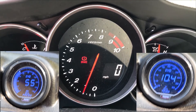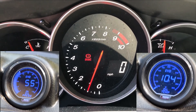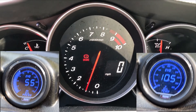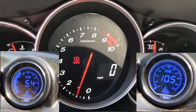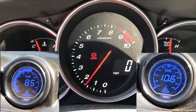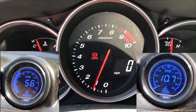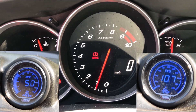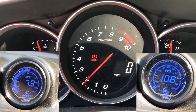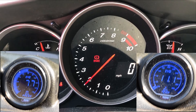This is a good example of how much oil pressure an RX8 set of dual oil coolers can handle. This one has been running this oil pressure for the last five or six thousand miles — just 133 in the car here, so it's pretty ridiculous what you can get for oil pressure out of these coolers. I'm going to run these in my peripheral port first gen this next season. She's going to be running about 150 PSI oil pressure. That's about two grand, 110 oil temp, sitting about in the high 70s.